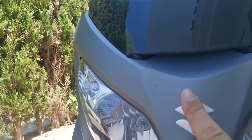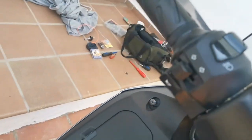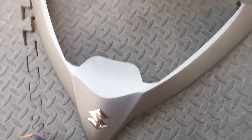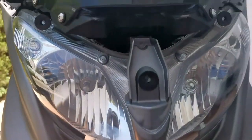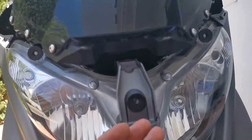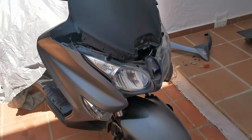So we've got a Phillips screwdriver, one each side - take them out. They come out really easy. There was a little pop plastic pivot thing in there, so I just pulled that forward and that was quite easy to remove, just the front of the motorcycle off.